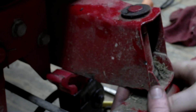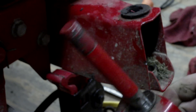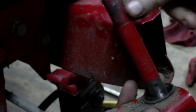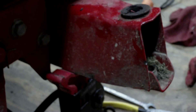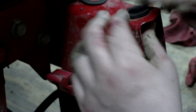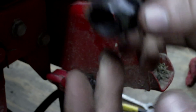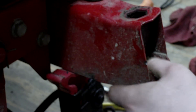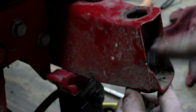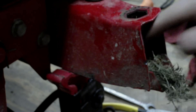The next step you need to do, you need to pull this whole axle assembly out. Just wiggle it and pull down at the same time. Now it's out. It's a good time to inspect this. By the way, the camera might be a little blurry because I can't get it in focus. You've got a washer here that goes on top, and these bushings — I need to get something to knock them out with. Here's the top one. The bottom one is the same. Might be a good time to clean all the grass out of here too.